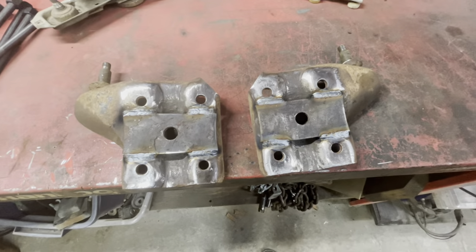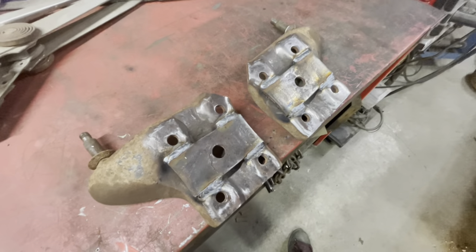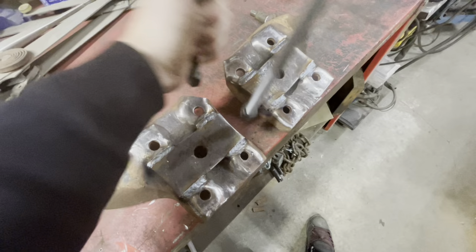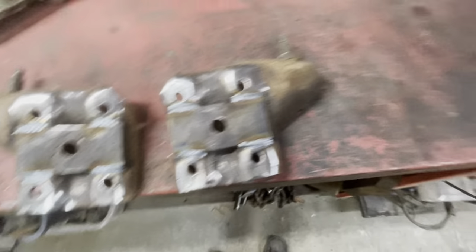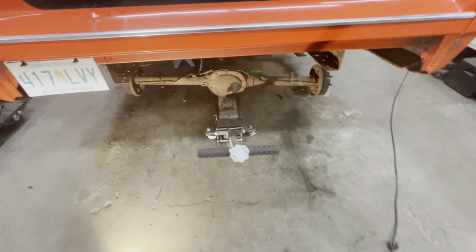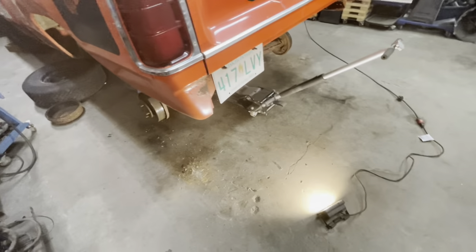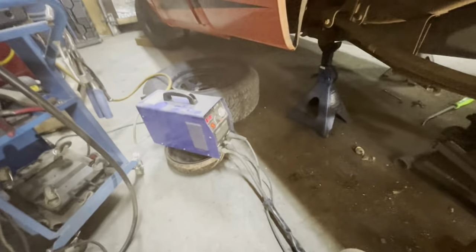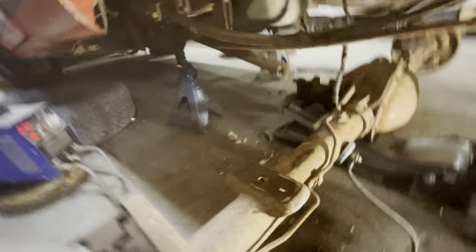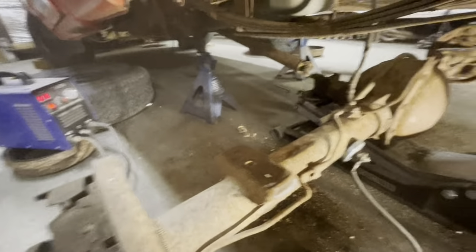You're gonna end up with something like this - it'll get bolted up underneath the springs now. It'll align in the holes and the round u-bolts will go over top the axle holding it in place. Next we have to cut the spring pads off this rear end. I'll get the plasma cutter out and cut those off - you can buy new ones, but I busted out the 200 plasma cutter and I'm going to cut the spring perches off, clean them up, and then weld them on the underside once we set the pinion angle.